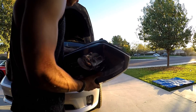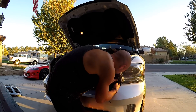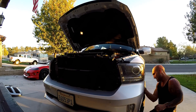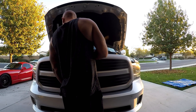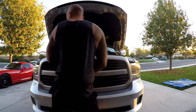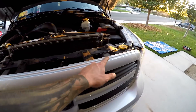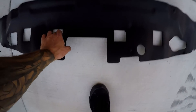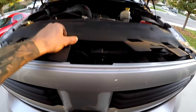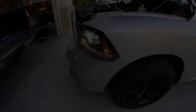This one's all set — go ahead and throw it back in. Get those two bolts in and do the locking tab. Both headlights are in. Throw the grill back in, put the four bolts in on top, and the last step is just to put the plastic trim back on, insert the push clips, and it's done.